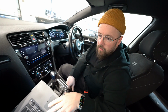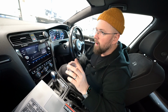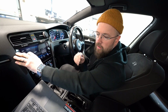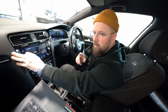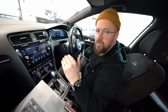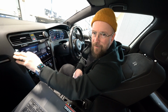Right, so I've got some tuning to do now. I know everything's working just fine. I've wound the gain right back down on the amplifier just for now, and then I might have to give it a little bit more lick on the mid bass, but we're working and we're sounding just fine. There's plenty of sub bass at the minute because I haven't got a DRC, so I need to leave myself with a little bit too much, so when I'm on the road it sort of levels out, because I haven't got on-the-fly control right now, but I will have shortly. It's nice and smooth, other than the sort of thick sub bass at the moment. Yeah, we're getting there.